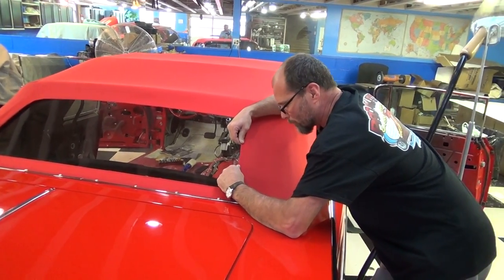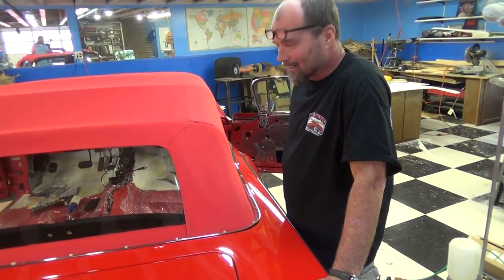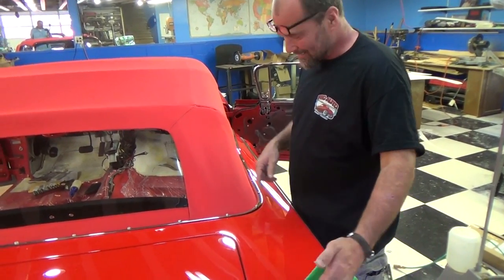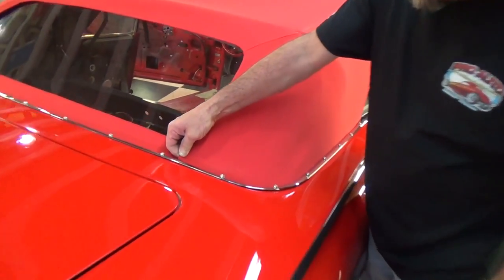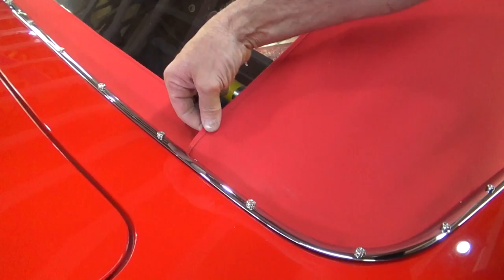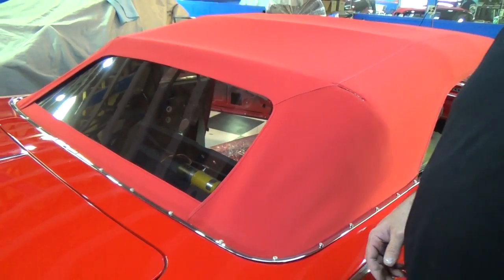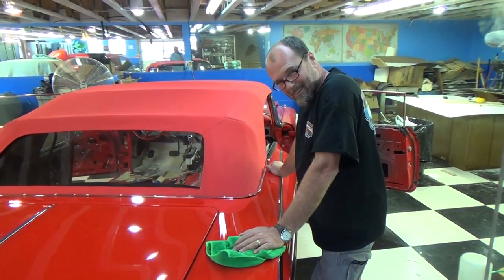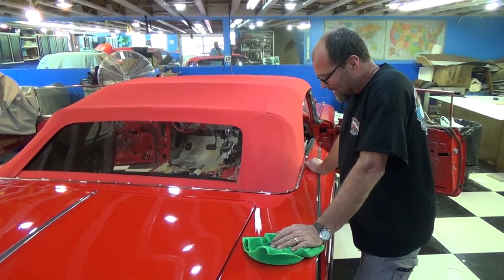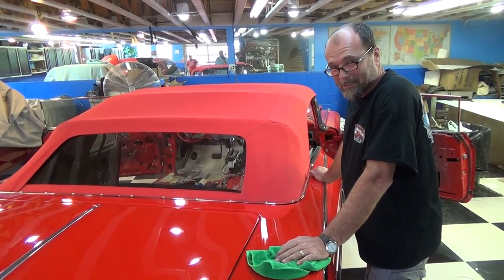It's a little flimsy right now after steaming. This is where the frustration comes in — I've got to take all this back apart again because it needs to be pulled down just a little bit, maybe a quarter inch, to get that slackness out right there. But that's a lifetime of wrinkles versus a little more time now. That's what you're paying for at Pro Auto Custom Interiors — very frustrating, but at the end of the day you've got a nice top.